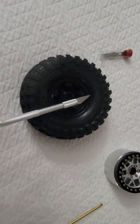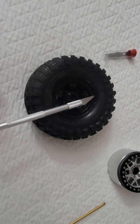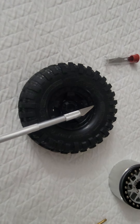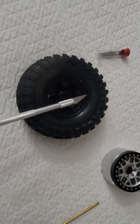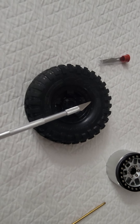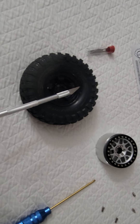If you've used your other blade or you think it's sharp or whatever the reason is, don't use it - just get a brand new one. You're going to be cutting rubber and if you have an older blade or one that's not tip-top shape, you're going to end up ripping the tire or not being able to make a straight cut, which is paramount.